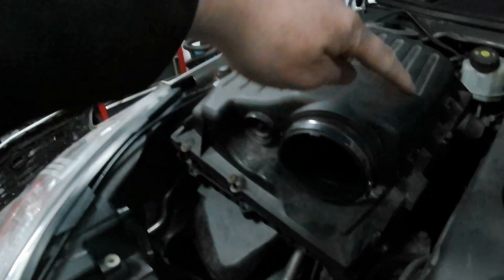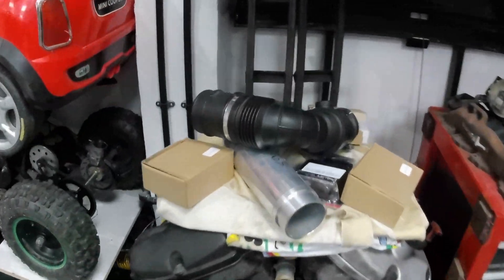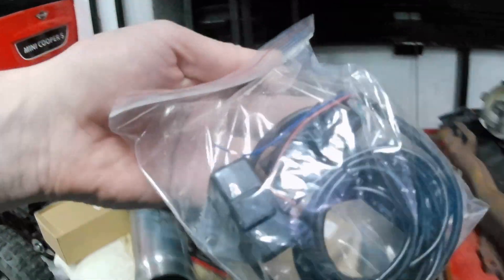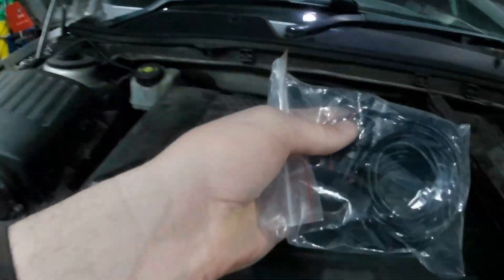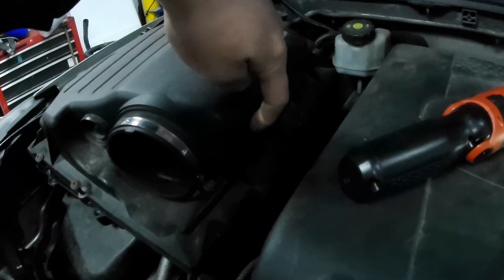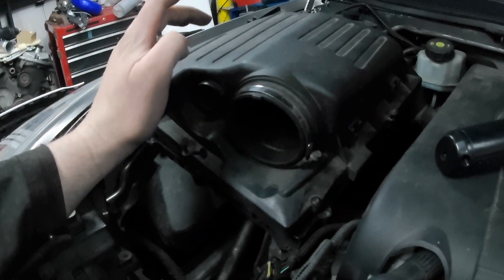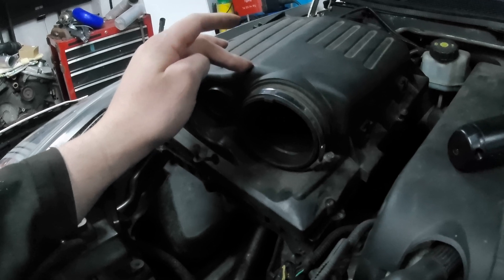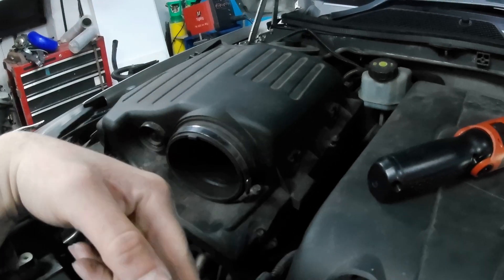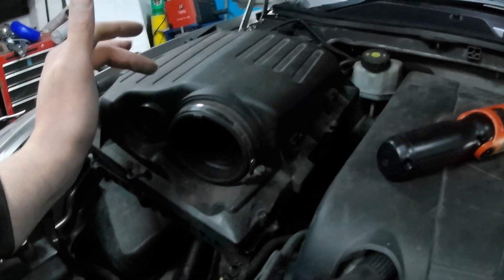I'm going to put a pressure sensor in the air box after the filter, which is over here — that one there. I'm going to fit this pressure sensor boost pressure gauge after the air filter before the turbo, and I want to see if there is any vacuum in there. It should read zero, but if it went to like minus 0.1 or whatever, that would indicate there's actually a restriction and I need to get a different air filter. But it's all just playing about and experimenting.